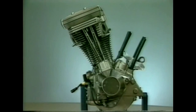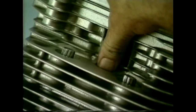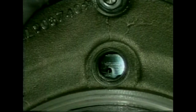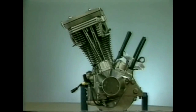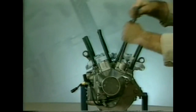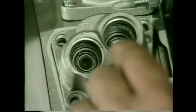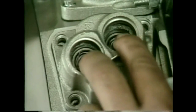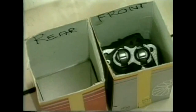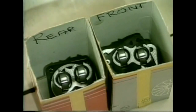Before we can remove the tappet blocks, we must first disassemble the rear cylinder. We should rotate the engine until the rear piston is at its top dead centre. With our thumb placed over the rear head spark plug hole, we feel for escaping air. Through the timing hole we can observe the dot which indicates the rear cylinder's top dead centre. We can now remove the rear cylinder in exactly the same way we disassembled the front cylinder. To remove the tappet block, we need first to undo the four quarter-inch bolts using a multi-hex socket, then remove them. With a large paper clip bent to shape, insert it into the oil holes of the tappets. Holding the wire back, we tilt the tappet block to break the gasket seal and remove it, complete with the hydraulic units and cam followers. Each unit must go back into its original bore, so store them in a clearly marked box covered with a rag to protect them.